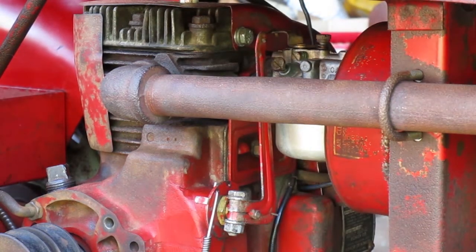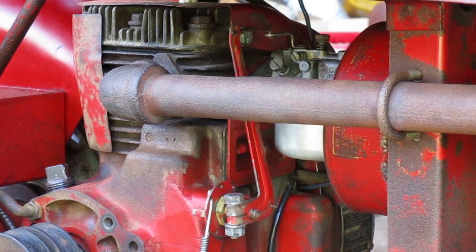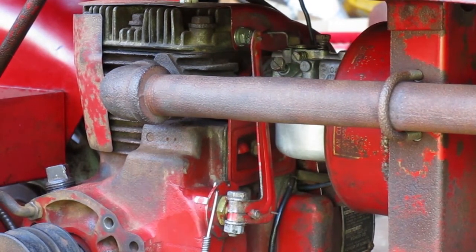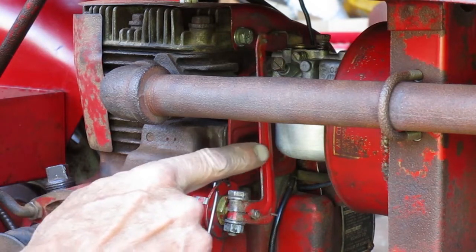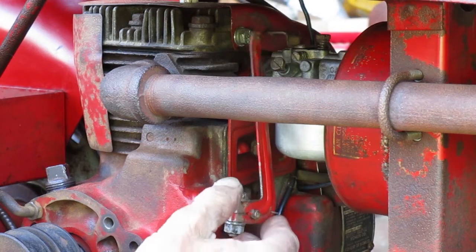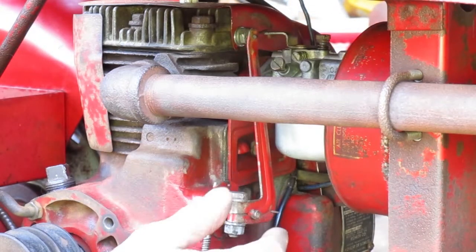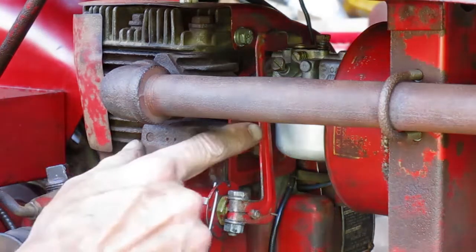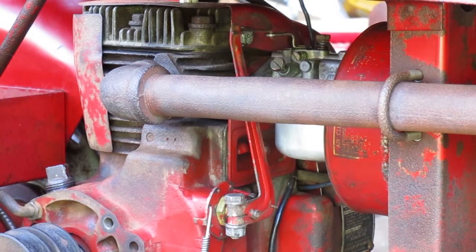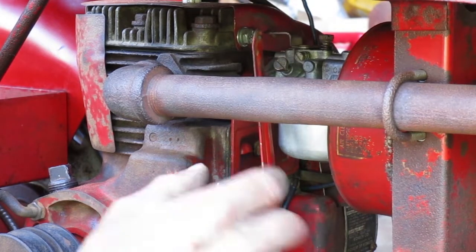After you make an adjustment, pull the throttle cable out and push it back to idle, because that's where it's going to be during operation. Then when you push the linkage to the idle position, the throttle should touch the idle speed screw and it shouldn't spring back. If the spring pulls it back towards you, the cable won't let the engine slow down to idle. Work the throttle a few times to make sure it's repeatable.